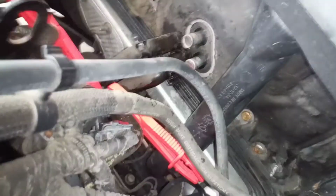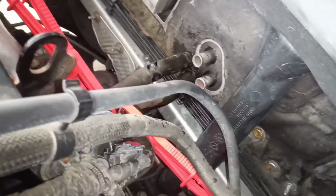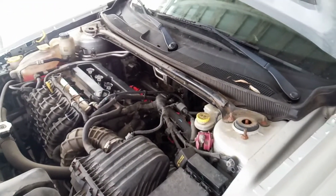If you don't have an air hose, you can probably just stick the little 5/8 heater hose we bought and blow on that really hard and get as much coolant out as you can. We're still going to put a towel underneath when we cut that thing just to catch any excess coolant. But all right, let's get cutting.